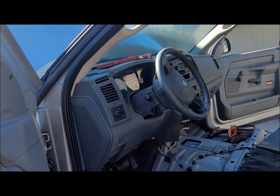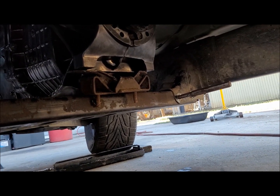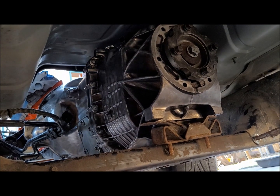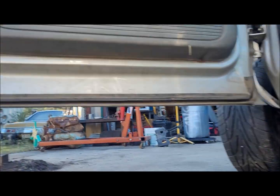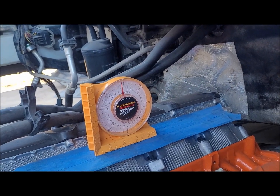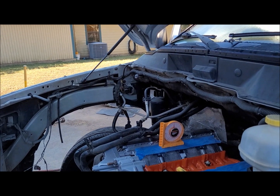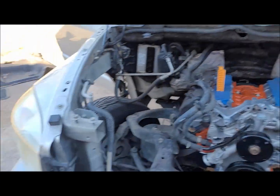The only thing I'm really missing is the plastics for the shifter delete, but that can come later. Got a '03-to-'06 48RE mount — as you can see it misses the cross member barely, so I'm gonna build a little cliffhanger off there and just bolt it like that. That's what I did on my '59 Star Chief for my Muncie swap. I'll probably put a gusset on each side. It's sitting at about four or five degrees, so I'm hoping the plate I use doesn't drop it much more than that. I could weld the plate directly to that so I don't have to go above it — actually that's a good idea.